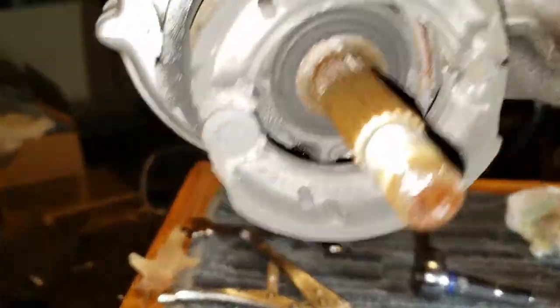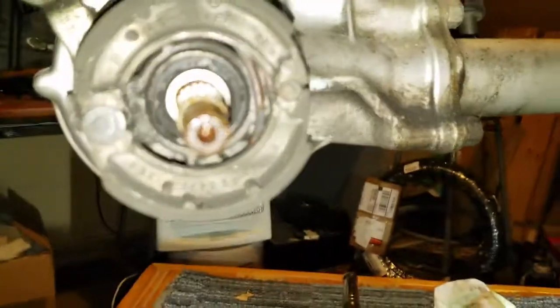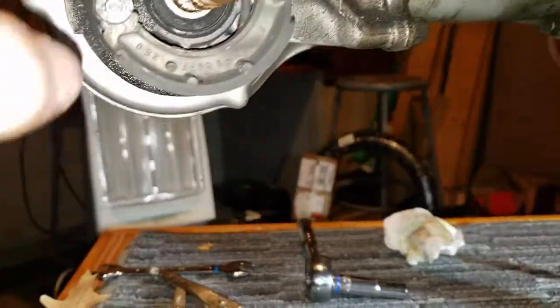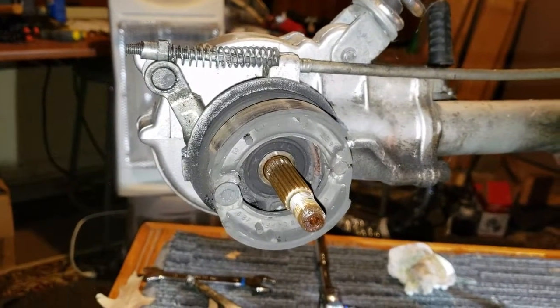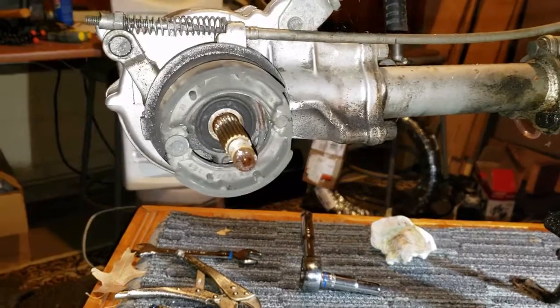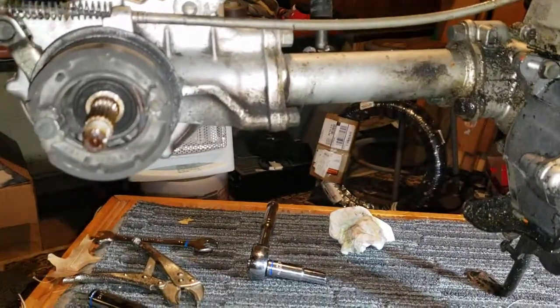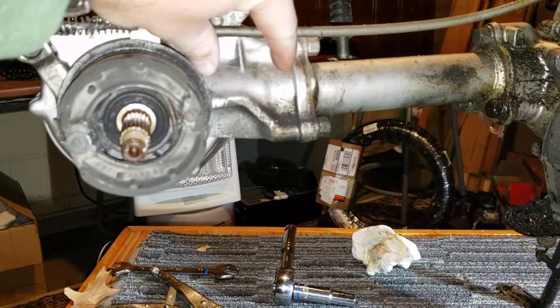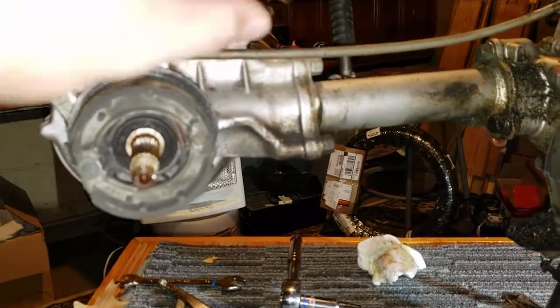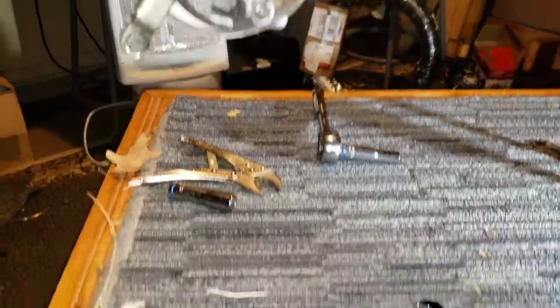There is a washer right here that you want to make sure you don't lose, because you will need that when reassembling — that's an important part. Here are the brake pads and they still look pretty good, so it might be some sort of cable or adjustment problem; it looks like it was adjusted all the way up. We're going to put the new brakes on since we're all the way down here. We're also going to take the three bolts holding this back end off — the suspension will have to come off — and inside here we're going to change the wheel bearings, and there are also some final gear drive bearings in here that we'll need to replace.